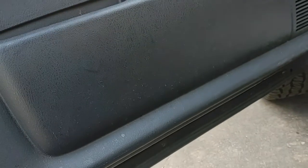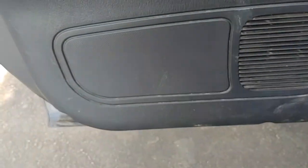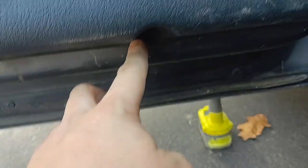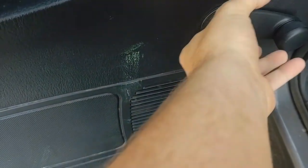That's one, two, three, four, five — those are the five screws you need to take out on that door. On the back doors if you're a four-door, you have one, two, three, and four. This one should be really simple to pull out, and then use the rag again to pop the clip out from the back there.